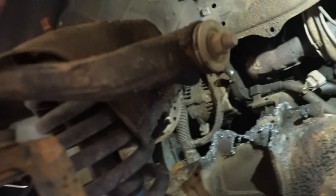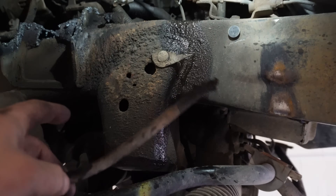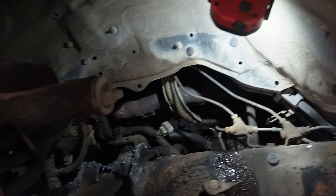Both shock towers are out, rack and pinion disconnected from the firewall, sway bars unbolted, brake lines are off. This one came off by fire - we need to just cut both of these crossmembers out. We should have the whole front end out of this thing by lunch, go get some food, come back, tidy it up, and cut all the brackets off the frame.